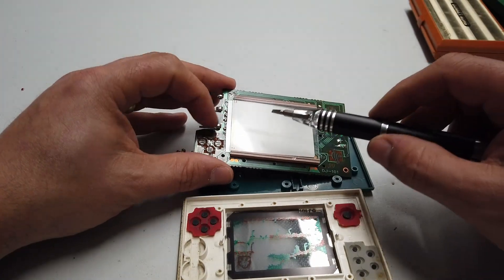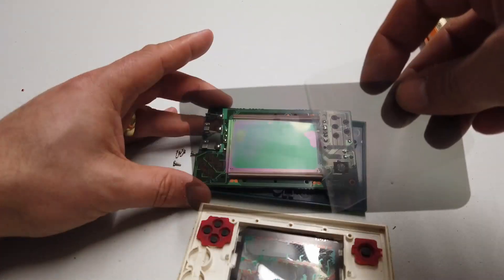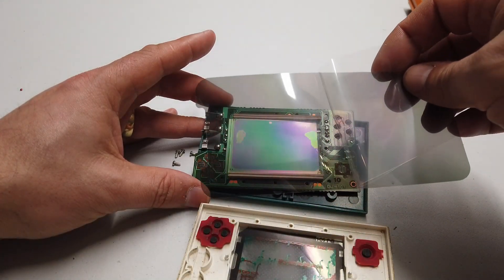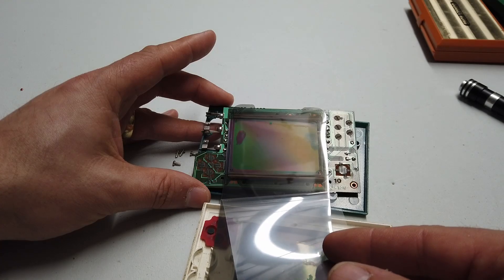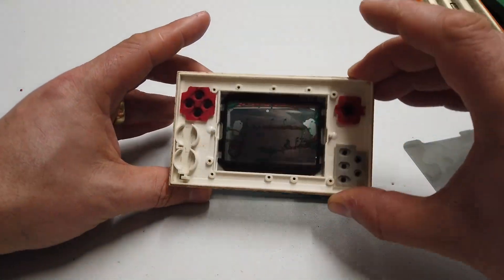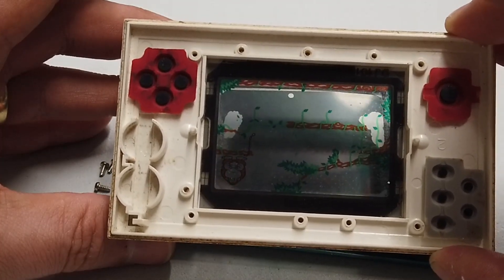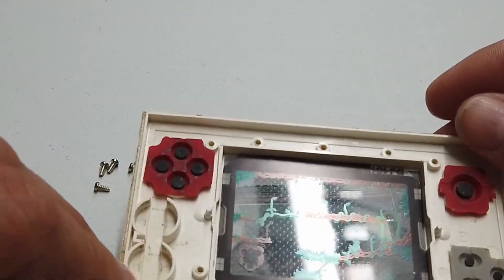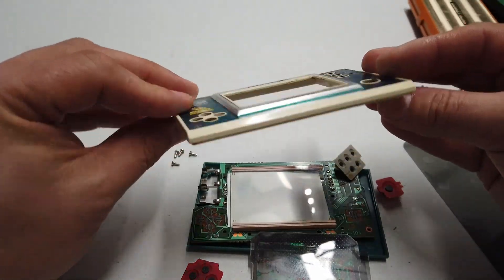There's a little piece of paper in the back — reflective paper — and you can see that it moves backwards and forwards. When I rotate this it changes the polarization of the reflections of light through the LCD display, and that's what gives you the black versus non-black. When I rotate that, everything goes black; rotate it back, everything goes back to normal. That looks like everything works okay.